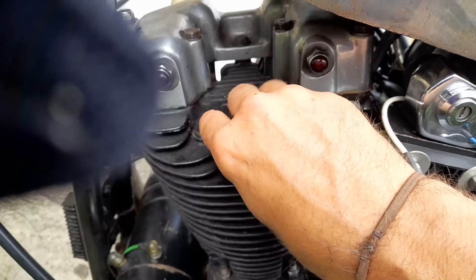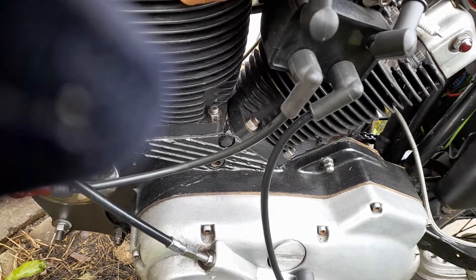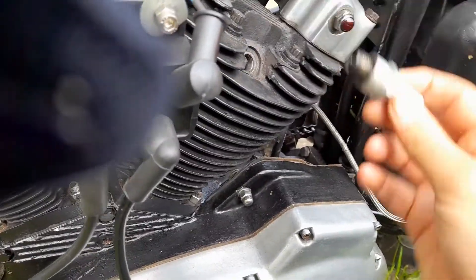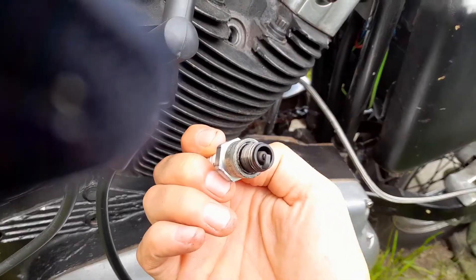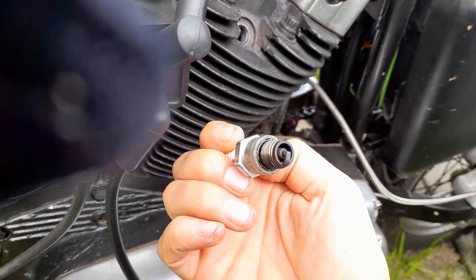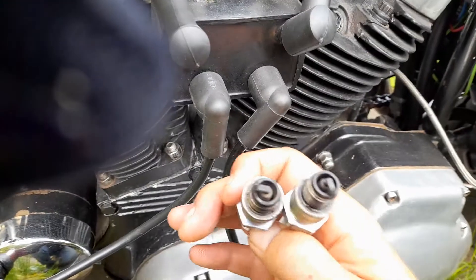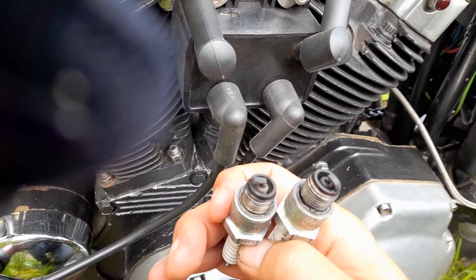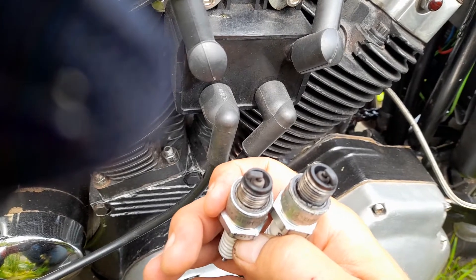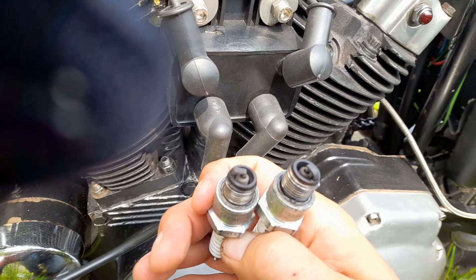Now, because the carburettor and ignition timing is the same for both cylinders, the other one's running fine in those respects. But if you look at this one, the central electrode is darker. That's not good. You can see the difference — the tan central electrode is to the left, and to the right the one off the back cylinder is darker.